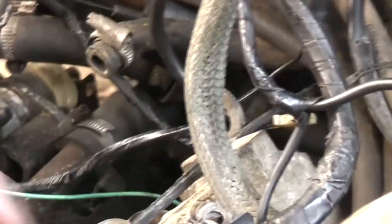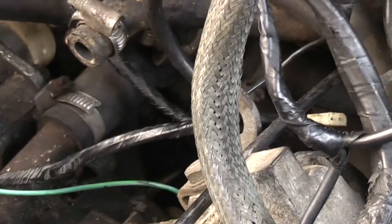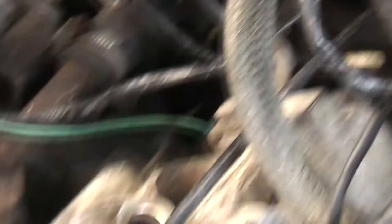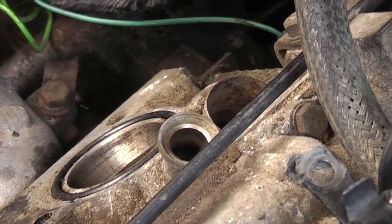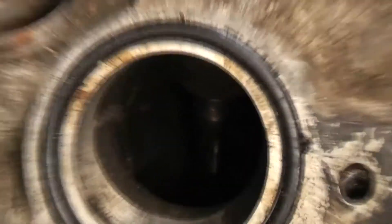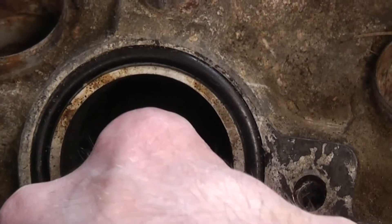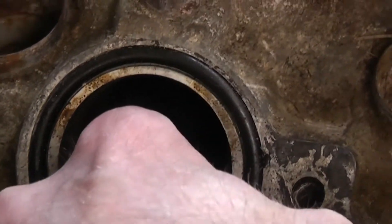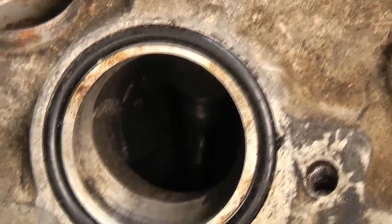We might be at the top of the exhaust stroke, beginning of the induction stroke, or we could be at firing stroke — we need to be on firing stroke. You can find out by taking the rocker cover off and watching the behaviour of the rocker arms. However, a much easier way is to stick your finger in there and turn the engine to the right. If after a quarter of a turn or half a turn the valve hasn't moved, it means you are at top dead centre firing stroke — which we are indeed.